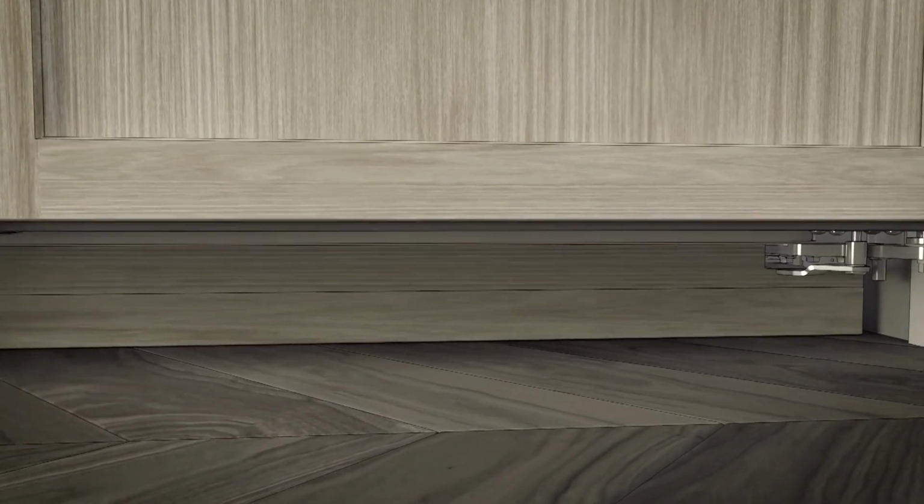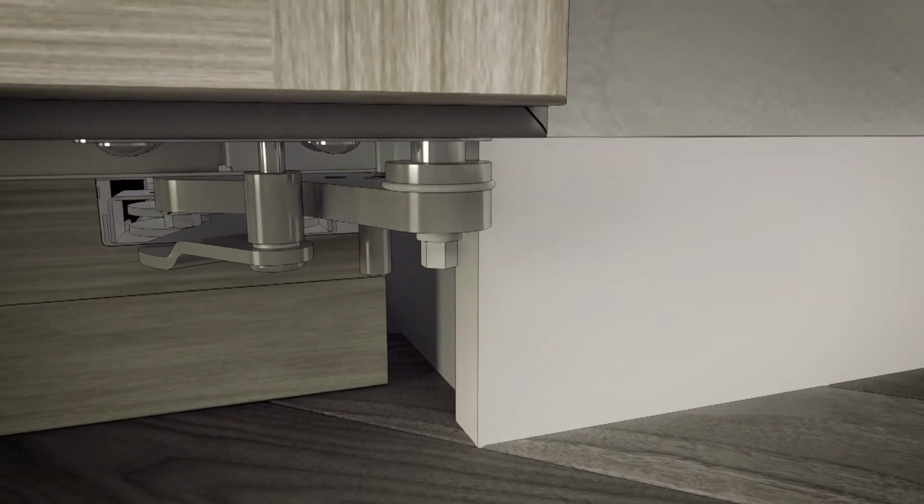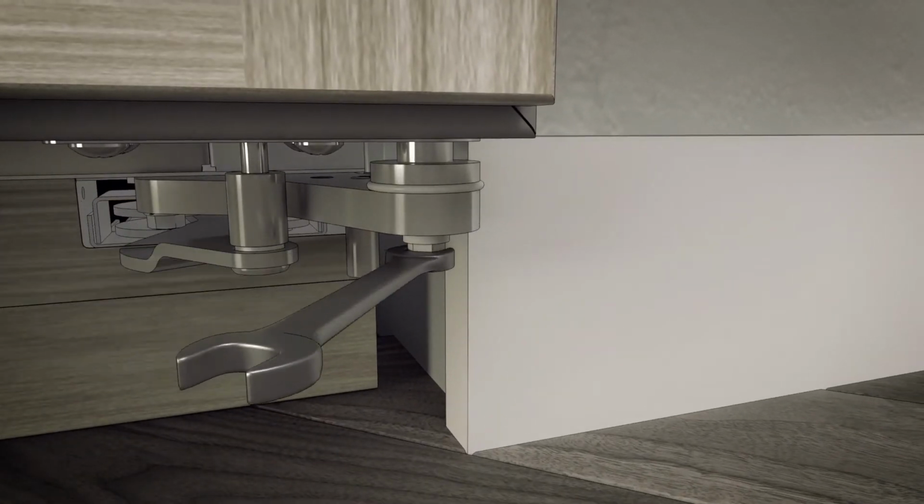Shipping or the addition of heavy door panels may have caused the doors to move slightly out of alignment. The fresh food door can be adjusted up or down to align with the freezer door. Use a 5/16 wrench to adjust the hinge pin.